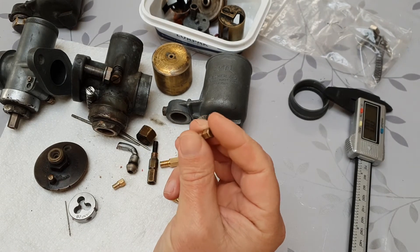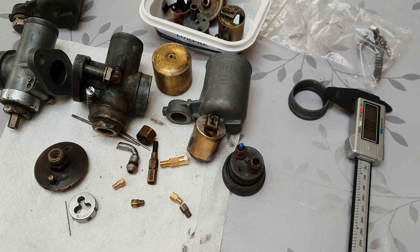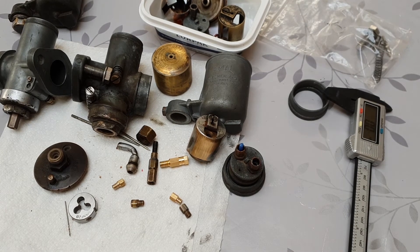So if you want 130cc through it in one minute, the tube needs to have a head height of about one metre. Obviously not many bikes have petrol tanks of that height, which led me to ponder — perhaps it's because the flow is increased when a slight vacuum is pulled from the piston. I can't decide whether that's accurate or not, but again if somebody knows, feel free to leave a comment.